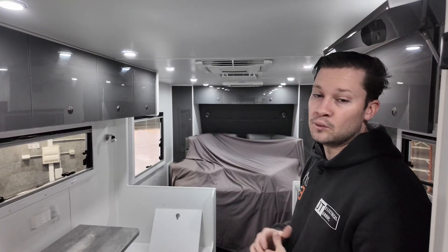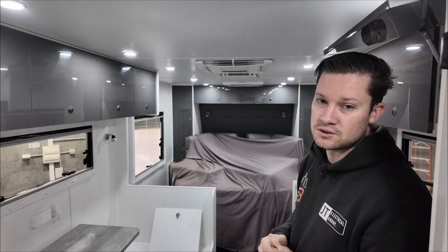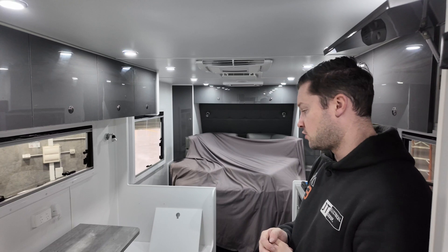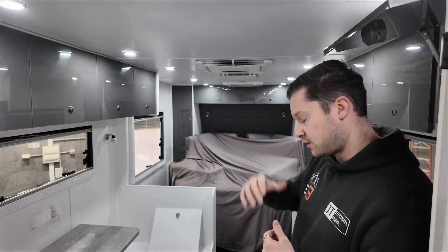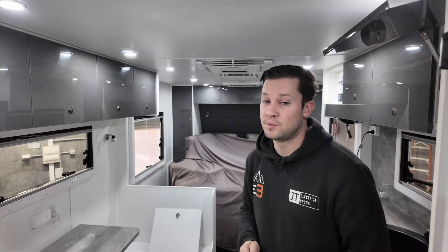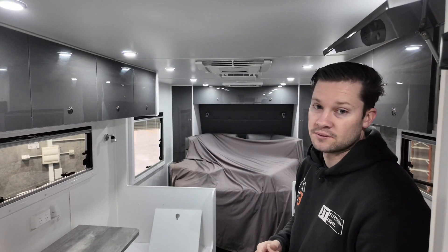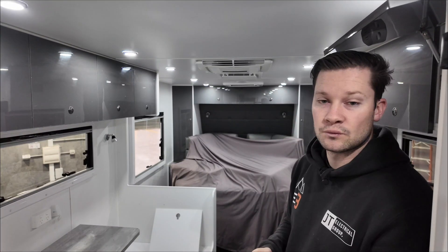He's got 600 amp hours and a kilowatt of solar on the roof, so with the two solar controllers he's not going to be losing charge unless he's cooking for a small family on a double induction cooker with no sun. He'll be getting at least 40 to 50 amps from the solar arrays, and while driving the DC charger can put in up to 50 amps — so potentially around 100 amps while driving. On a 600 amp hour system, six hours of driving with good sun will recharge the whole system from flat to full. If you've got any questions, ask in the comments and I'll do my best to answer them.